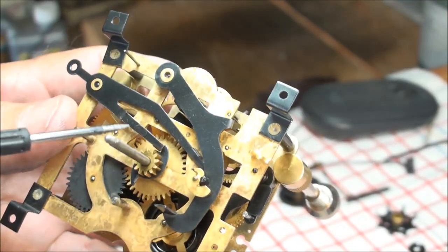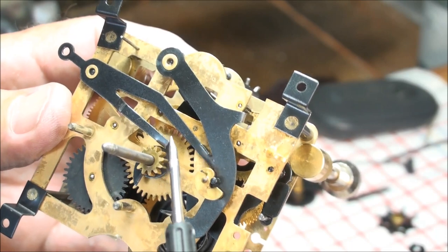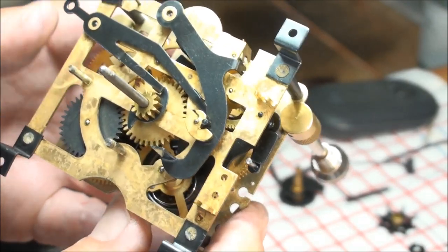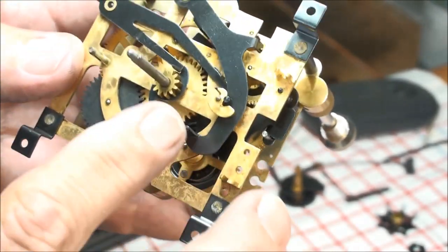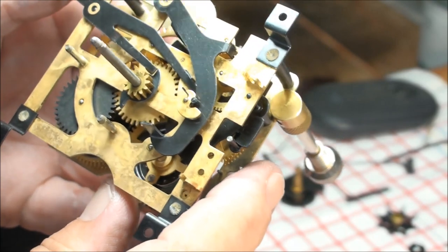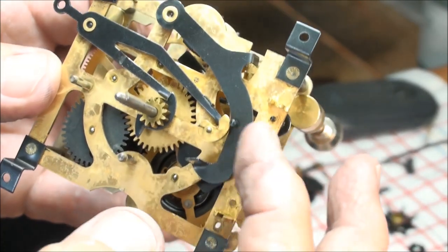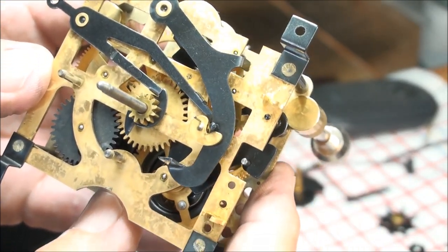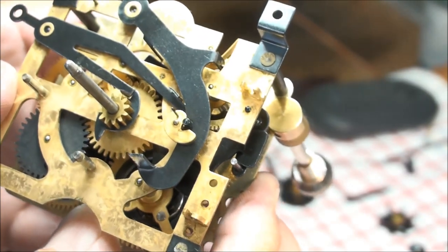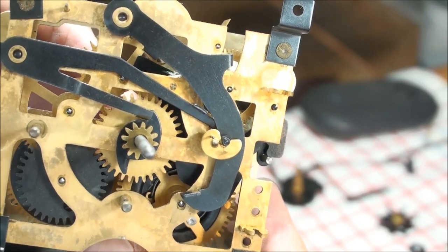So when you get ready to set the timing, this here, I moved it so it dropped down, so it's ready to, let's call it, cuckoo. And doing that, now I can go ahead and turn this. Don't worry about the flopping of this, because this is normally setting up a little bit, not falling down as far as it is. You can see the Pac-Man is ready to drop that lever. And it should stop there, but it's going just a little bit past. That very well could be good, but realistically I'd like it to fall clear down into its mouth right there.